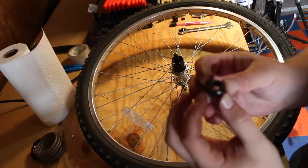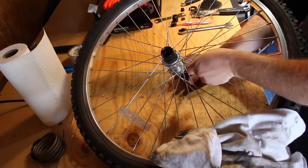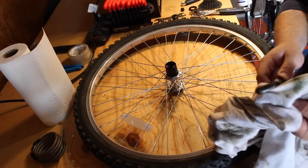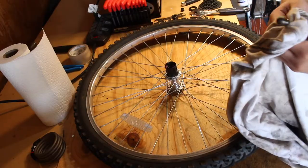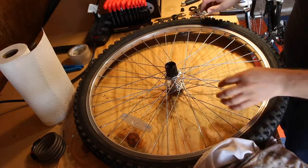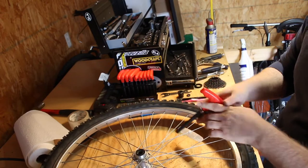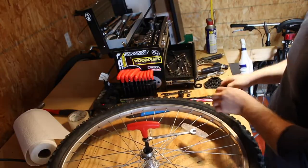You should be able to back the cone out all of the way — there's the cone right there. This one looks to be in good condition, so I'm going to save it and keep it. The bearings also looked like they were in very good shape, so I reused them to rebuild this hub. Note that I only took the cone and lock nut off of one side of the axle, so that when I rebuild the hub I don't have to redo the centering of the axle. The wheel will stay in the same position it was beforehand.